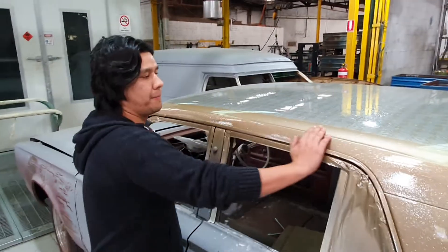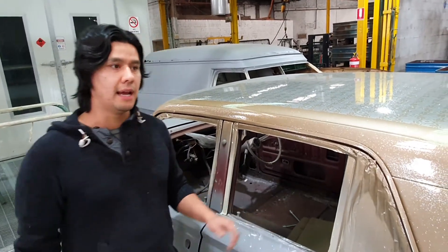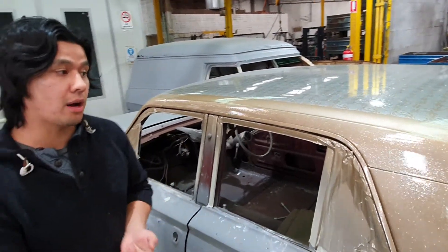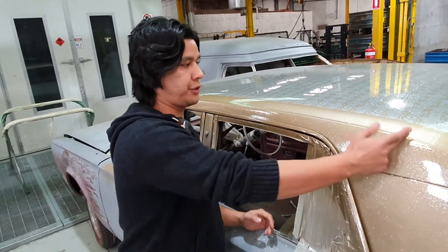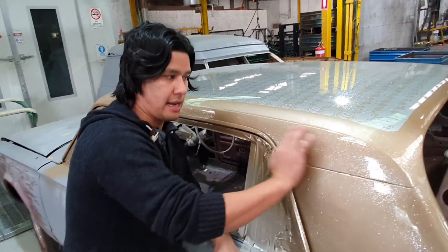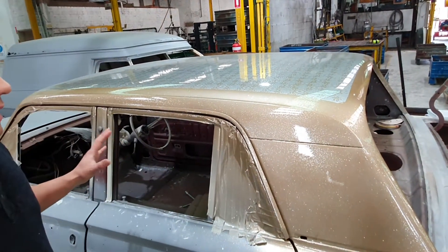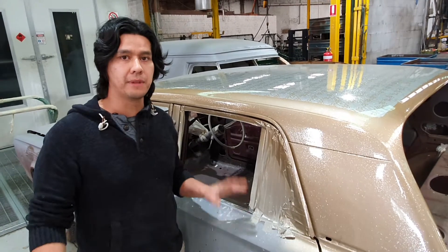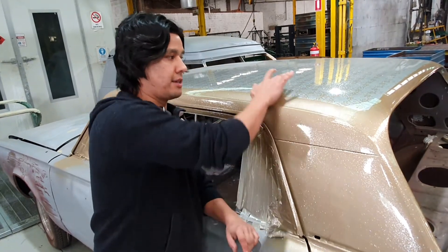I had sanded it back to bare metal, applied epoxy primer with no filler, then scuffed up the epoxy primer. I laid a gold base coat and in that gold I put some flake in there. But on the second or third pass I found I was actually covering the flake, so it was bumpy but you couldn't see any of the reflections. I made a mistake there, but this car is to learn on. I then sprayed clear coat over that, left it a bit, then scuffed up the surface with 800 grit so the next layer — the silver lace — would stick.